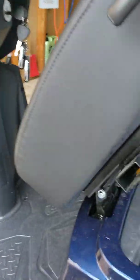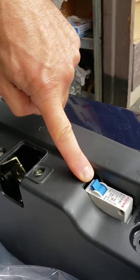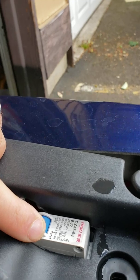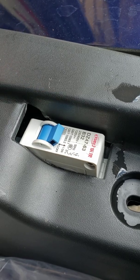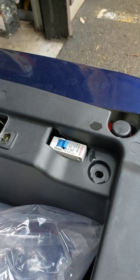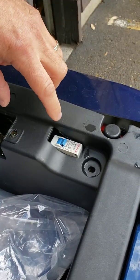Open your seat and check if your breaker switch is not in the off position. There is a little sign showing on and off right here, so make sure it's set to on, which is supposed to be flipped to the left. Now if your scooter still not powering up, it can be a problem with the switch itself.